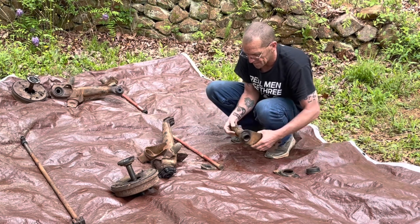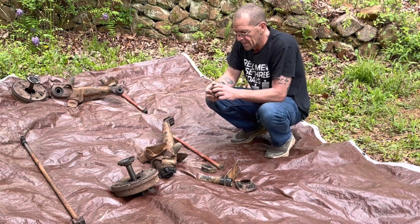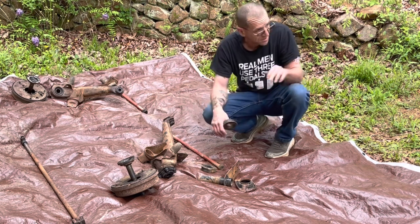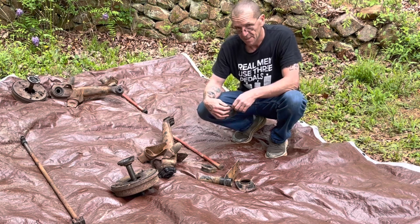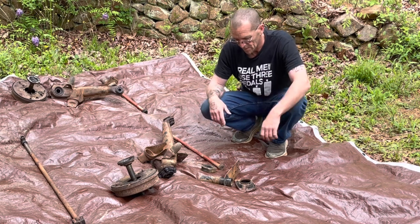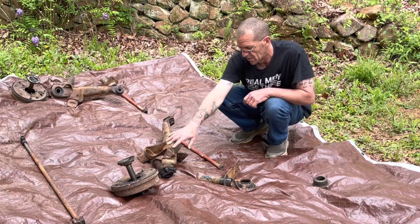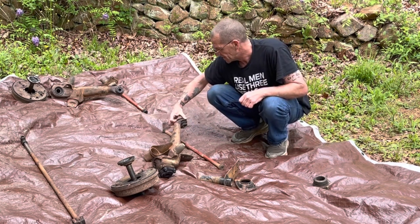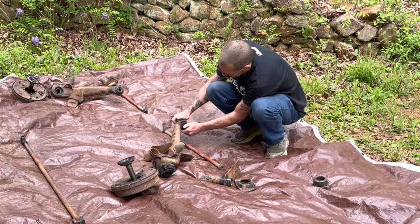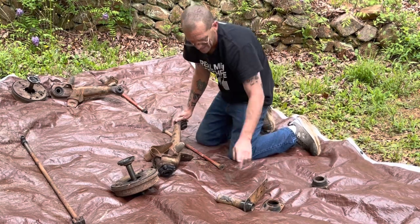The main reason I would do air suspension on the rear — I had actually planned on doing it on the front too — is for when I go to car shows, and also to make it easier going up and down my driveway, because my driveway is really rough. So I've ordered new urethane bushings for the trailing arms, new urethane bushings for the torsion bar mounts, and all new bearings and spacers. I'm going to go ahead and strip all this stuff out.